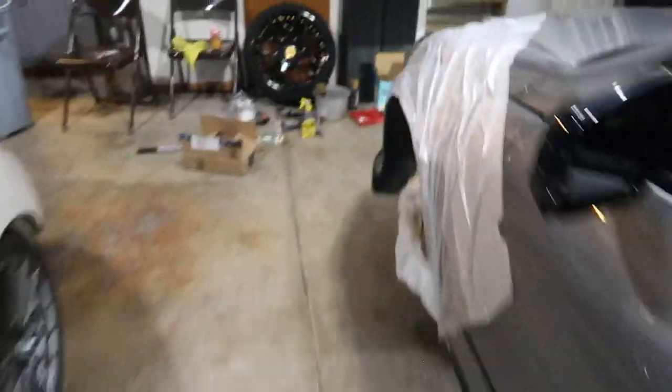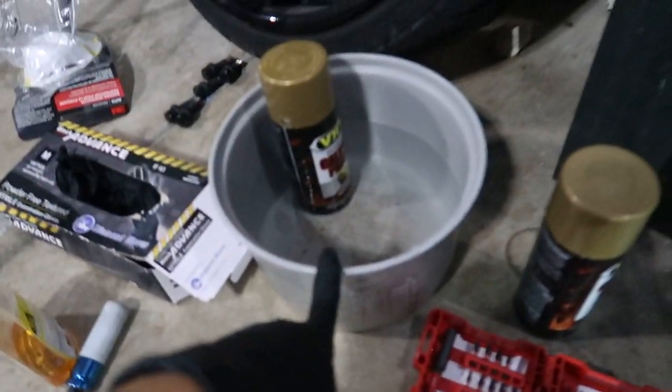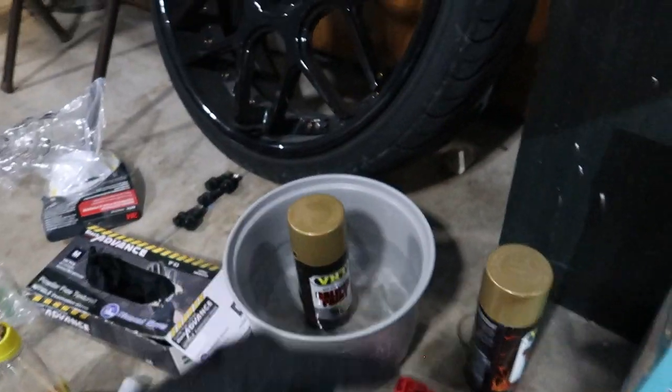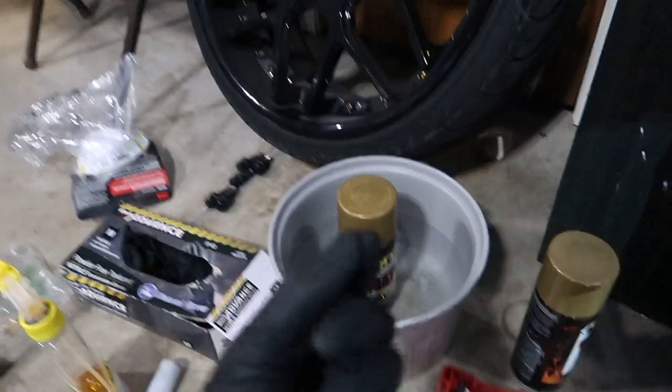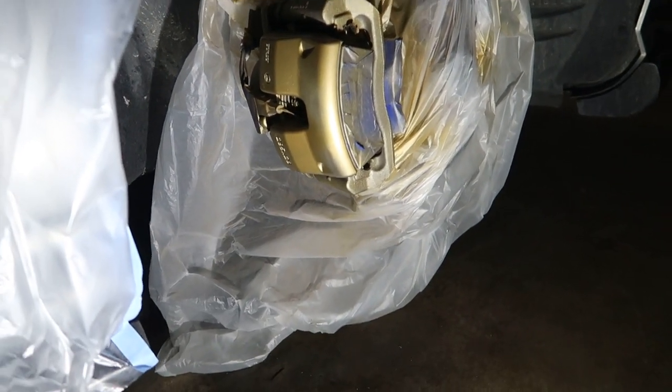And key, before you always use paint, no matter what, put it in a bowl of hot water. Why? It thins out the paint. So whenever you spray the paint, instead of big dots, it's like super, super small dots, and it's fine paint, and it just comes out way smoother and looks better. Good light first coat, even though it's not even, that's fine, because you can come back in and fix it more.